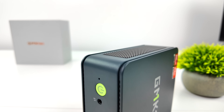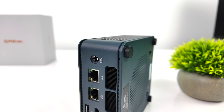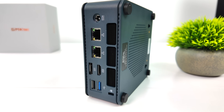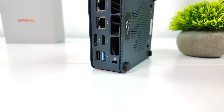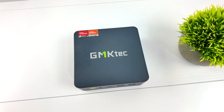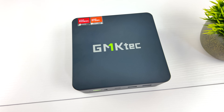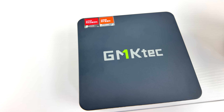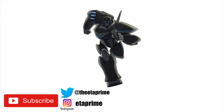Overall, the new GMK Tech K6 is performing really well. Glad that they have that wattage on up, and the fact that we can actually adjust it from third-party software is really nice. Some of these newer mini PCs hitting the market with Ryzen 7000 do have kind of a hard lock, but seeing that we can really adjust this to our liking is very, very nice. It is coming in a bit bigger than their other version with the 7940 HS, but we do get that extra M.2 slot, which I think is a big plus. Once the wattage is correct, we've got a bigger cooler in this — it can perform just like that 7940 HS variant. But that's going to wrap it up for this video. If there's anything else you want to see running on the GMK Tech K6, let me know in the comments below. I'll leave some links to their official website and Amazon. Thanks for watching.